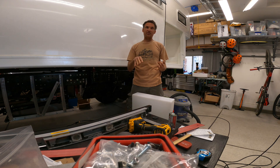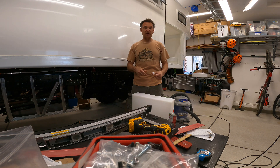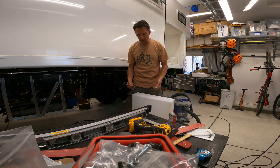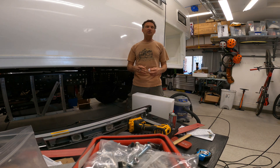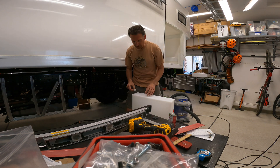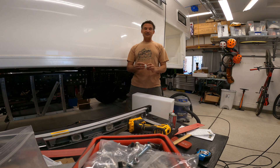I'm going to have to compress that bulb with the cabinetry. Fortunately I've got this nice aluminum cabinetry framing — I'll be able to apply pressure and compress it down, that will not be a problem. It really blew up quite a bit during manufacturing. I thought that expansion would settle down once I put some holes in to let air out, which usually happens with these fresh water tanks — they're usually made at about sea level and I live about a mile high in elevation. But it obviously did not let out enough pressure.